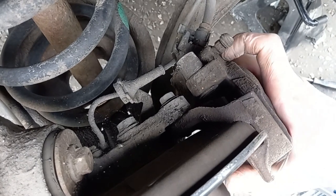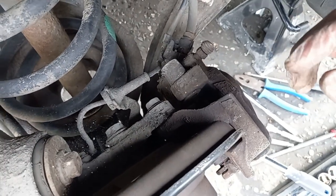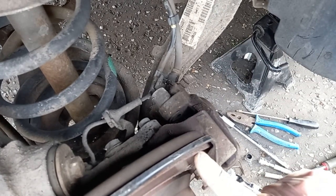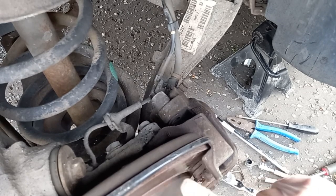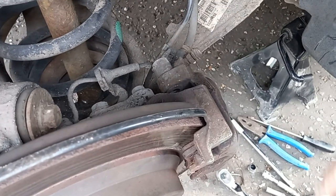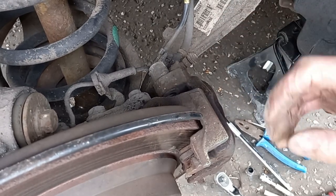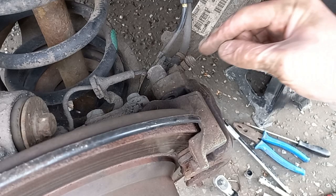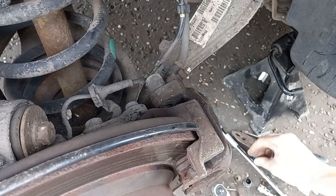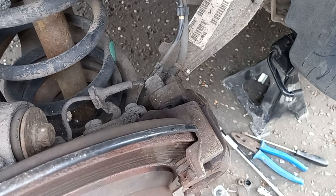You can see it moves just a tiny bit - I'm going to give it a bonk with the rubber mallet. The problem we've got here is that the pads are clamped inside the rim. There's quite a lip here on the rim because the disc is so old and worn out. So I'm going to have to release some of the brake fluid in the caliper itself, which will allow the brake pads to be expanded out so we can slide it off. That little rubber cap is where you find the bleed nipple - I'll go and get a jar and some tubing so we don't leave a big puddle of brake fluid all over the road.